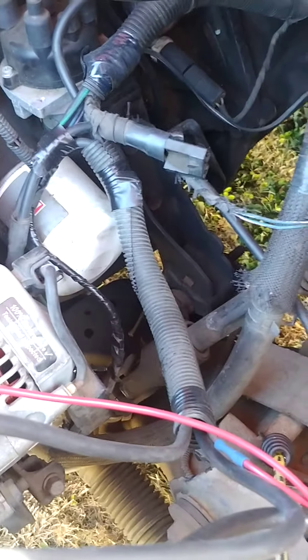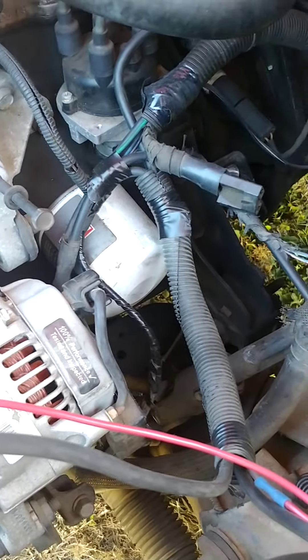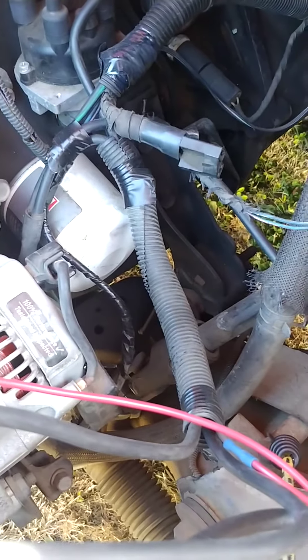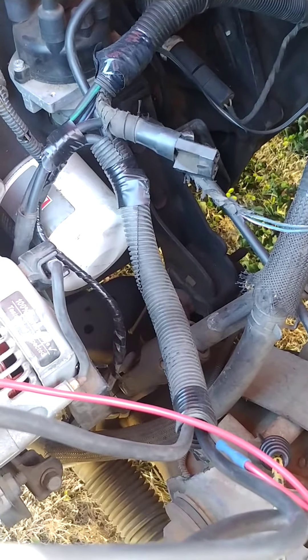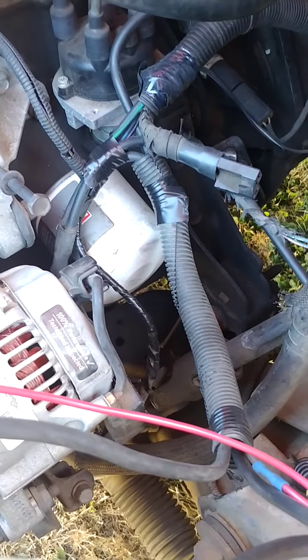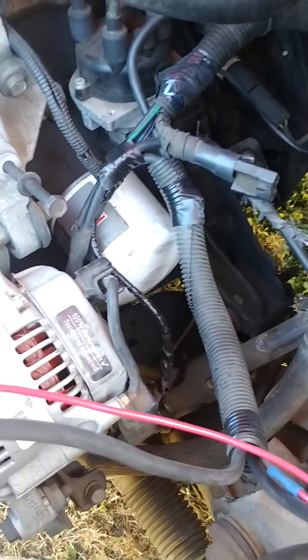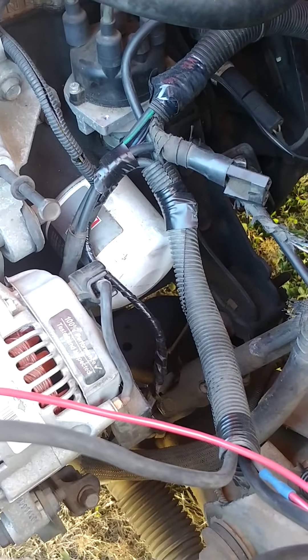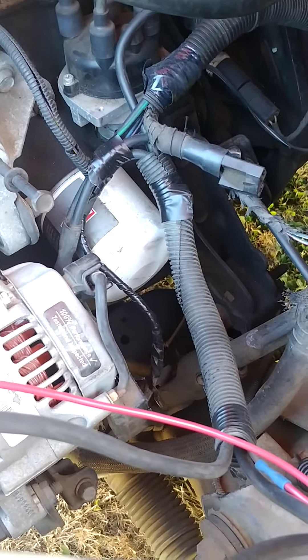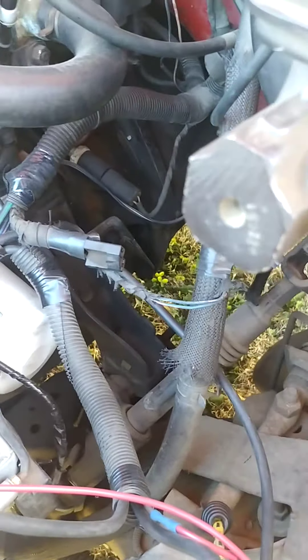Before I did this electrical work, I couldn't get the truck to start, so I shot it with starting fluid and it fired. I wondered if the truck was out of gas because the gauge lies to me. After doing the electrical work I tried to fire it up and it wouldn't fire again — even after adding gas it still wouldn't run. I shot it with starting fluid and it started right up. That told me I had a fuel pump issue. I'd just replaced the fuel pump two to three years ago, so basically I got a bad fuel pump — a whole lot of problems.